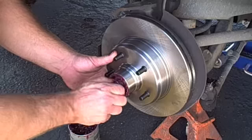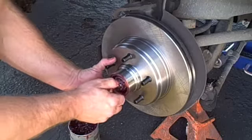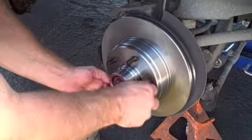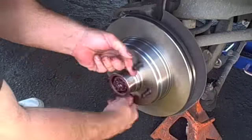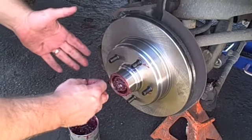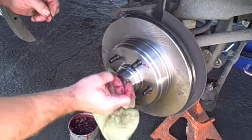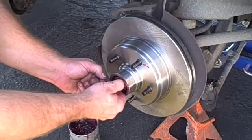Once the nut is all the way on, use pliers to do just a quarter turn — you don't want it to spin more than about two revolutions. You want it snug but not too tight. Spin it back and forth a couple of times so the grease seats inside the bearings and make sure it doesn't wobble loose. Then spin it to make sure it does a complete revolution — that's fine for me. Take your cotter pin and find where it needs to go, since the nut is notched. Line up your hole wherever needed to get the cotter pin in.